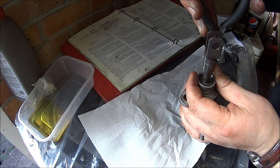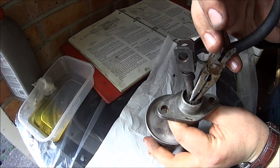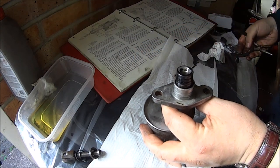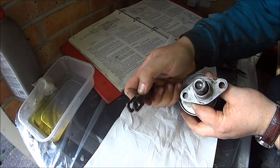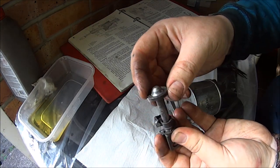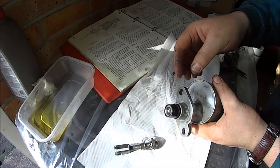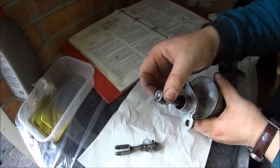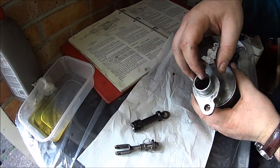You just slot in and squeeze it together. So left on the plunger here you've got a couple of parts. There's a little washer which fits over the end of the plunger. There's a collar which I think is for the rubber boot to ride on. And your little circlip there as well. If you just give this a little pull — if, like mine, your car's been sitting for over 10 years, this will probably be full of gunk.